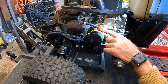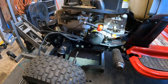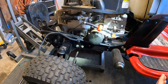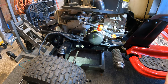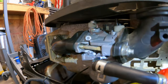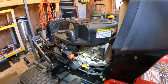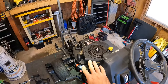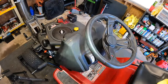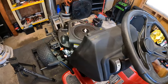That is in place. Slide the breather hose back on — that's just a breather hose for your crankcase to be able to ventilate. We are basically all set there besides hooking up the fuel hose. I'm going to go ahead and get that other fuel hose all prepped with our new hose filter and shutoff valve. I just went through and got the fuel valve installed — cut a small piece with the hose supplied, then put in the fuel filter and just used another small piece. Now we can turn the fuel back on, wait for a minute, check for leaks. Before I crank this up, I wanted to show you guys — we've got plenty of clearance on that choke arm. So make sure everything clears and everything is functioning. I will go ahead and turn the choke on just because we have a new carburetor, and I heard the solenoid click, so let's crank it.